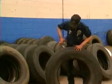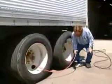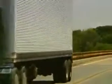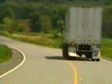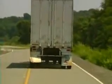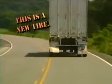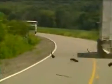Therefore rubber on the road for the most part is a tire maintenance problem. While road hazards contribute to a large number of en route tire failures, properly aired, matched, and well maintained tires experience a much lower rate of road failures. Tires which are overloaded, under inflated, or carry a heavier load due to being mismatched generate substantially more heat than properly inflated tires, and heat is a tire's worst enemy. As a tire without sufficient air pressure rolls down the highway it becomes hotter and hotter until the components inside the tire come apart. When this happens the tire disintegrates, littering the highway with pieces of scrap rubber.